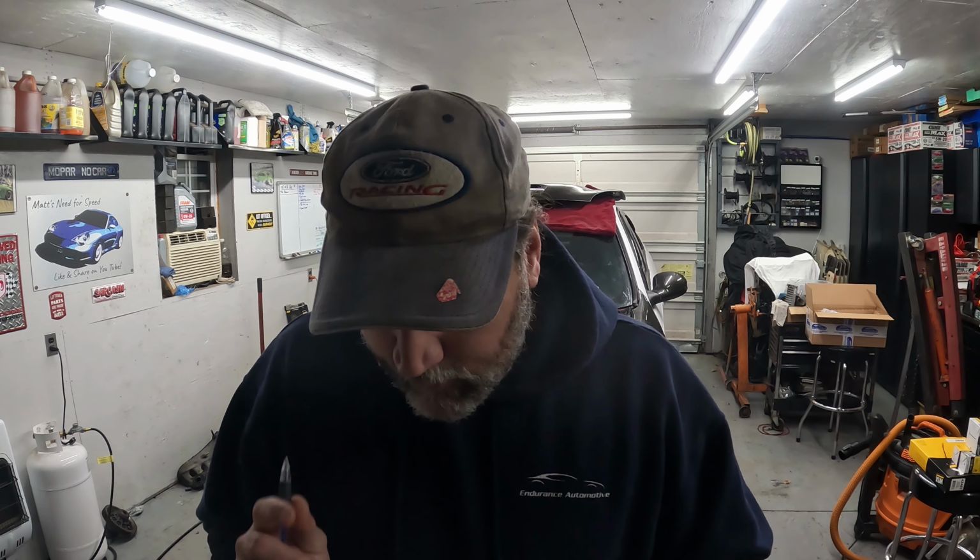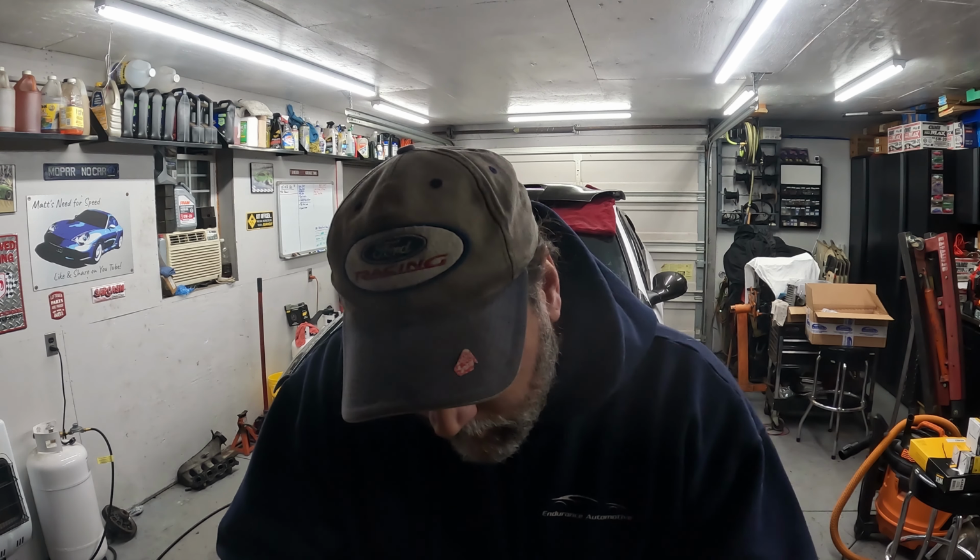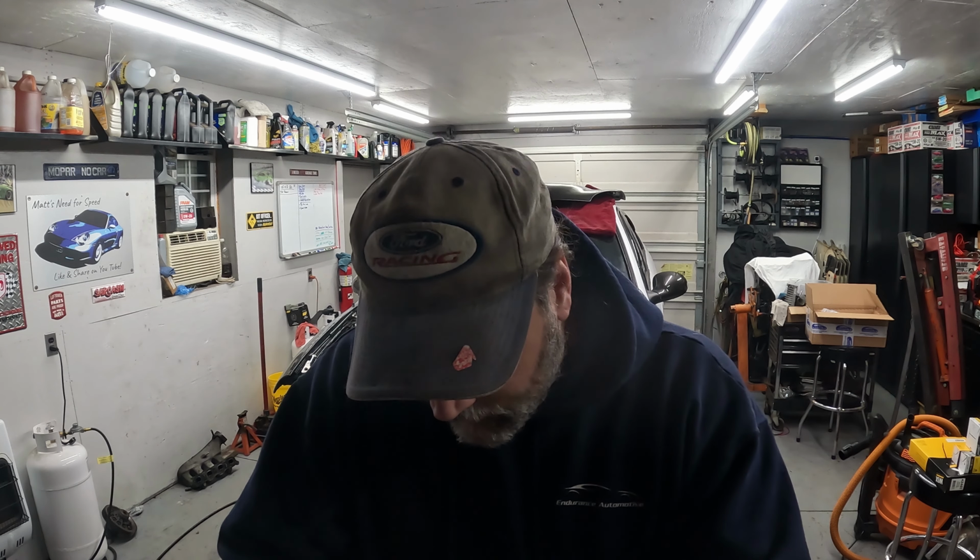If I can find it here. Okay, so basically we want to get this thing started up and running. There is some wiring that needs fixed. Fuel line needs fixed up. There's no ground wire going to the engine because they relocated the battery to the trunk. Speedo sensor and the oil thing wasn't plugged in. Turbo drain hose. Just a lot of stuff needs to be finished and then fixed. So let's just take a quick look at everything that I found here now.